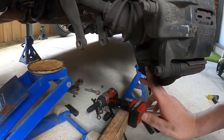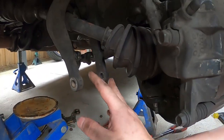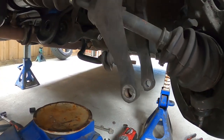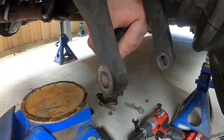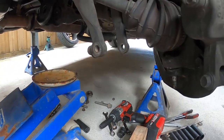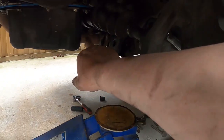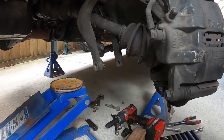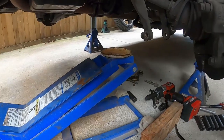The original stock one is out. It's just a matter of undoing the ball joint here, smacking that pretty hard with a hammer, undoing where the suspension goes — or if you have coilovers, just undoing the bottom bolt there — disconnecting the sway bar, which requires an allen key in the end and then a 14mm there, and then there's a 19mm at the back and a 17mm just there. It's a little bit tricky with the sump on the B series — it kind of gets in the way. Came out with not too much drama. I was a little bit worried about the ball joint but just a bit of a whack and it came off. You should be able to do this in your driveway.